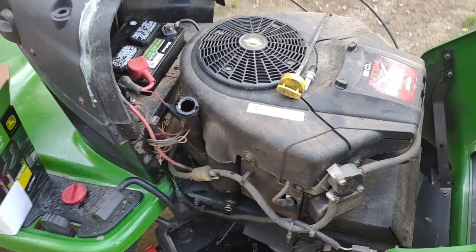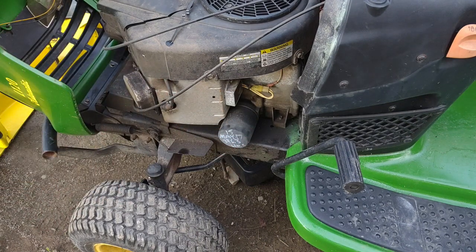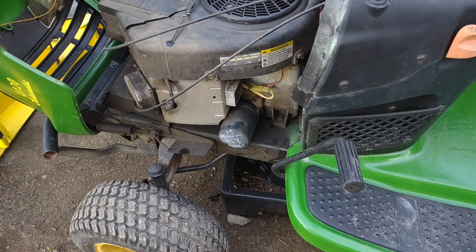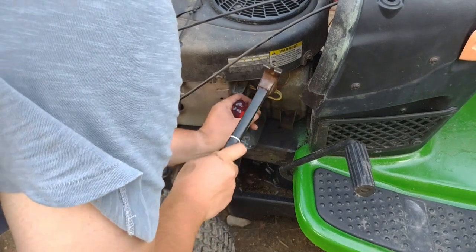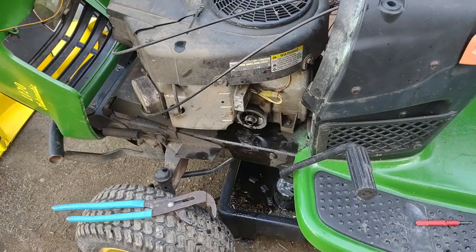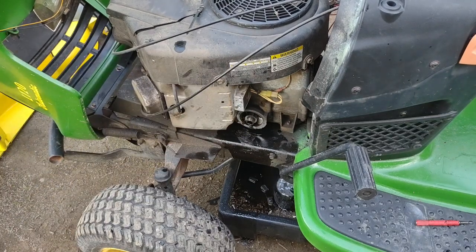There's one more thing we have to remove to complete the oil change — the oil filter. To remove it you unscrew it this way. These are supposed to be on hand-tight, but somebody has probably cranked this one on. Remember to put an oil pan under the frame of the mower because there's an extremely high likelihood of quite a lot of oil in that filter — it's going to drip everywhere. One method for a stuck filter is to stick a screwdriver through it and turn. This one proved quite difficult — it's the thickest oil filter I've ever seen — so I used a punch to punch a hole in it and get my screwdriver in. I ended up resorting to water pump pliers to get that filter off. It was the strongest I've ever felt one on these mowers.